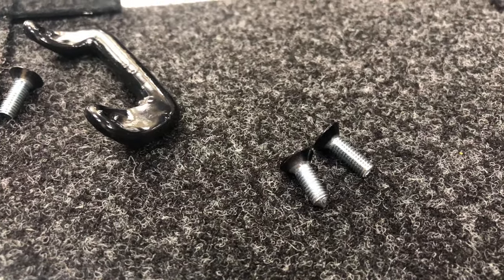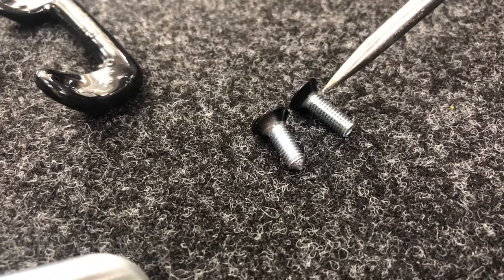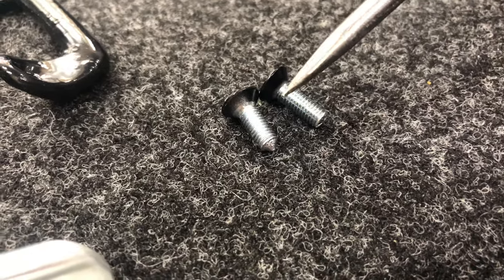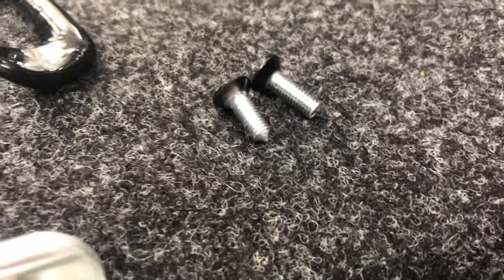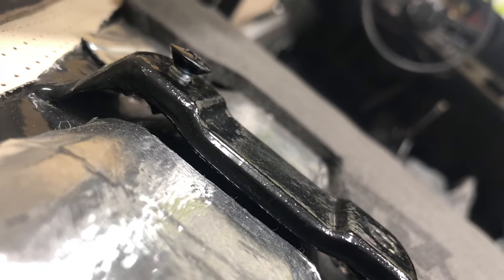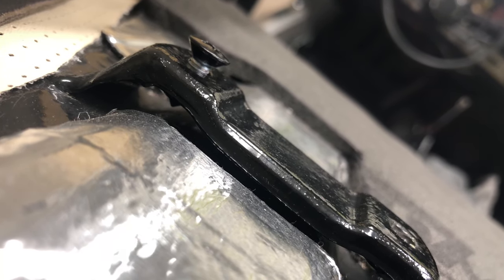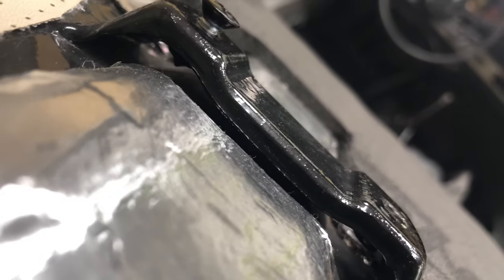Our luggage strap anchors are pretty straightforward. The difference between the screws is this straighter screw goes towards the footwell down inside the car, and these ones with the tapered point go up on top of the deck. Looking at those tapered screws from the top side — you can see as it's drawing down, if you don't have that tapered point the screw is going to hit the body before it draws up and gets seated. That's why they put the tapered screws there.